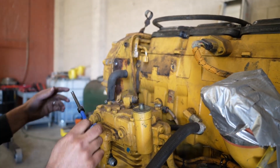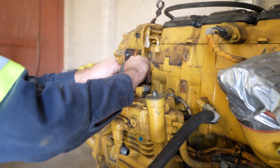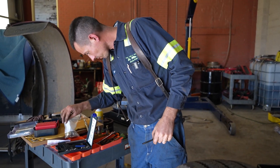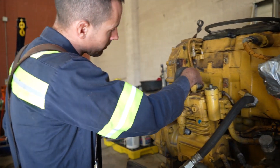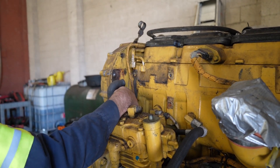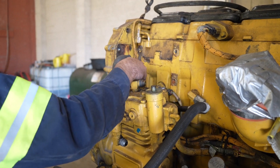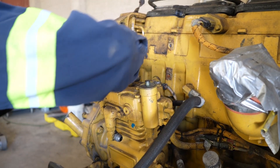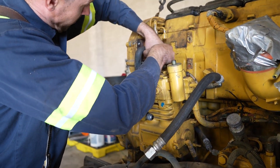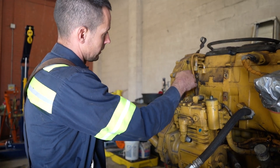The main thing is you don't want to force it and break that little tab off the back, because then you're not going to be able to turn it anymore. That looks like it's all in. I always get a good new bolt before I break the tab off. It won't go in quite right, so it needs to go in a little bit further. We got that in a little bit deeper there, and I always just like to test a bolt in it to make sure it goes in and out — which looks good. This one's good, this one's good.